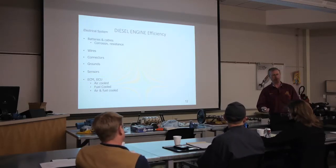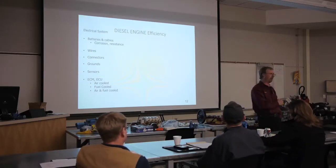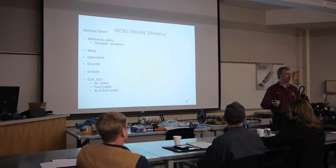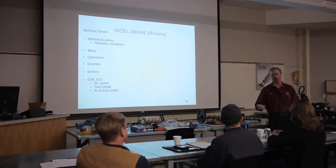So if you have a startability problem on a hot day, we've done a bunch of field work, we come in for lunch and we go out back, the engine's still pretty warm, hard starting. Well, maybe that's because the ECM is saying, whoa, horse, we got an issue here. All right, so they will self start shutting things down. It could get to the point where we're going to start burning up transistors and diodes.